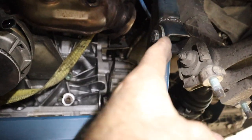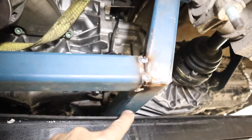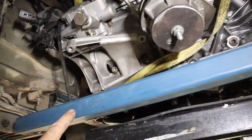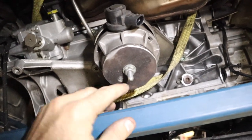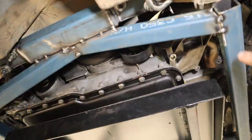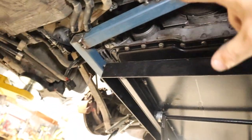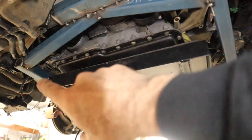This is the mount under the suspension point near the gearbox — that's where it bolted on. It comes down and joins up to the bar, which goes underneath the engine all the way across creating a subframe. I've welded sidebars on all the way down to the front, sitting underneath the engine mount — I've got to build a standoff and weld it onto the base plate I made. Then there are two arms on each side that come across and join up to the subframe. It's basically a box all the way around the engine, with the engine mounts sitting on either side bolting up to the suspension point. I'm very happy with the design of that subframe.